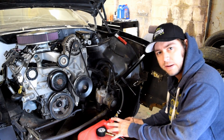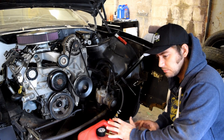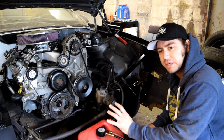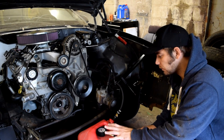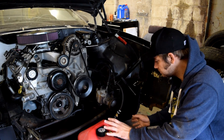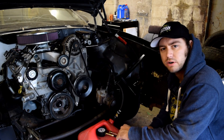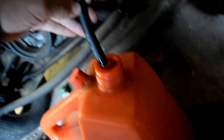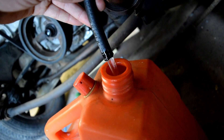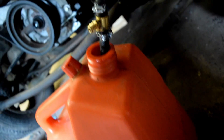If you're swapping over from fuel injected to carburetor, like for an LS motor, you'll just have to change the fuel pump — it's a pretty cheap option and it goes in the tank. I'm draining all the gas out of the tank right now — there's about five gallons in there. I want to get all the bad gas out, then once I change the fuel pump I'll put fresh gas in. Whatever bad gas you're not gonna use, put it in your lawnmower or something.